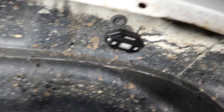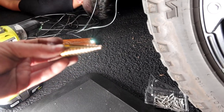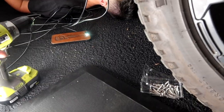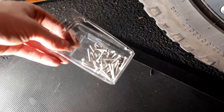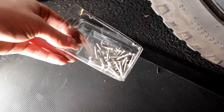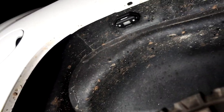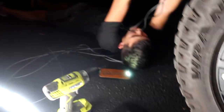The camera cut off a bit but we have the next two mounted in the rear as well. We're using a step bit — a tapered bit — to drill the hole for the wire to pass through, and a fine bit to drill the mounting hole for the screws. We're using one-inch number-six stainless steel self-tapping screws, which don't come in the kit. The kit comes with bolts and washers, but getting a nut on the back side is nearly impossible, so the self-tappers are much easier. Moving on to the front where we have plastic — that'll be a lot easier.